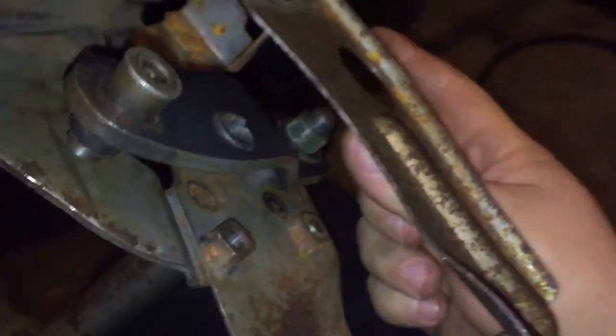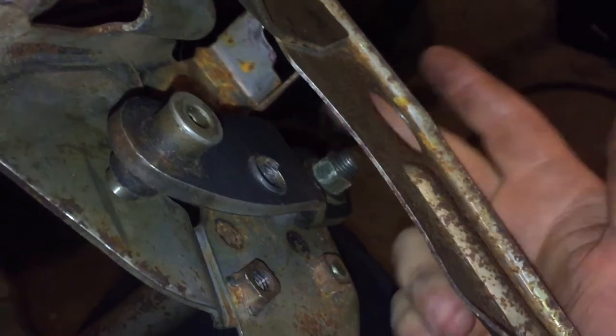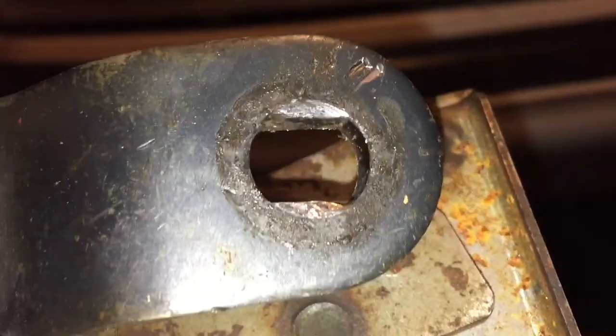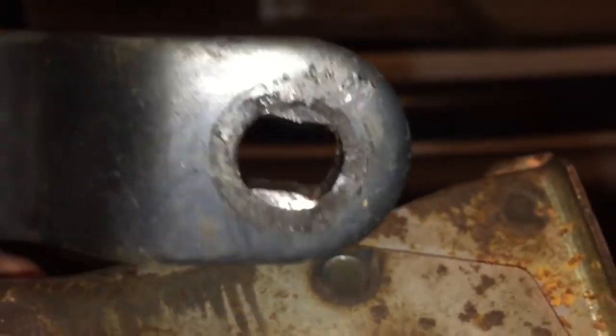The weld might work, might not. If it doesn't work, like I said there's a kit — I think it's J&Z or something online, about $88 for the whole thing. So there's the clutch pedal — it's kind of flat right there and flat right there. Inside you can see it's kind of getting oval. Yeah, it's all messed up right there. That's what causes the slop — it stops being flat all around, starts to get oval, and that causes the clutch pedal to go out on these 1Gs. Apparently it's a common issue from what I was reading.